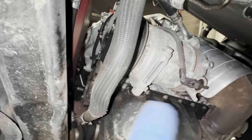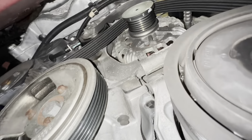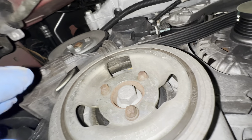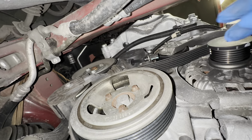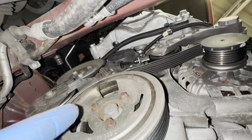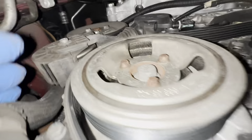If you've got it on a tray you will need to remove it — it's a 10mm. You can also take this cover off to make it easier, so I'm doing it from this side as you can see. You can see the tensioner down there, so you'll need to pull this out and that will retract, and you'll be able to take this belt off, making it easier from that side.